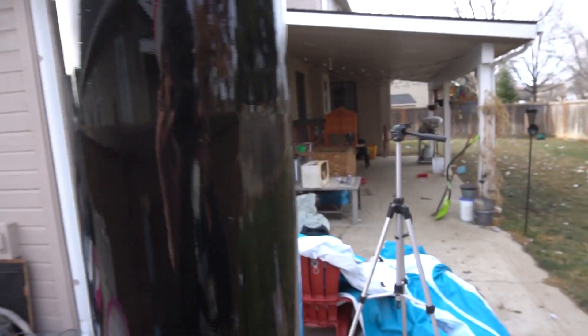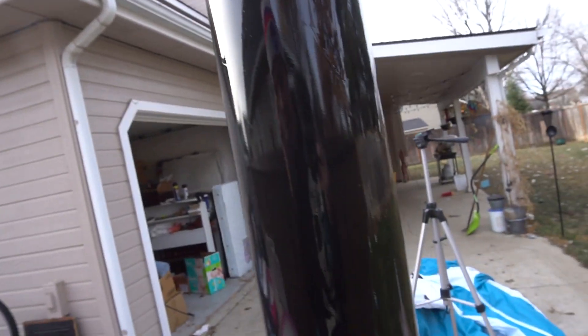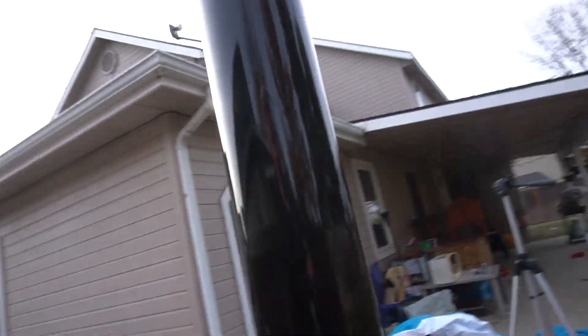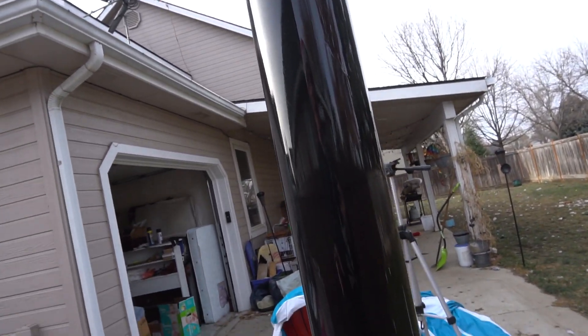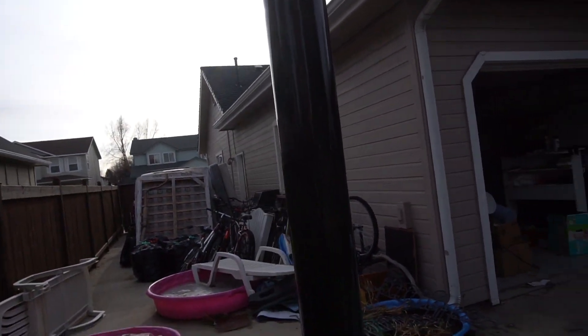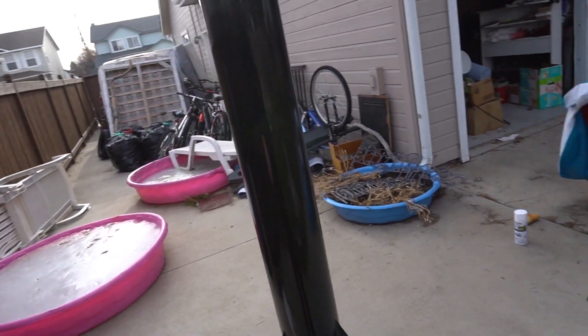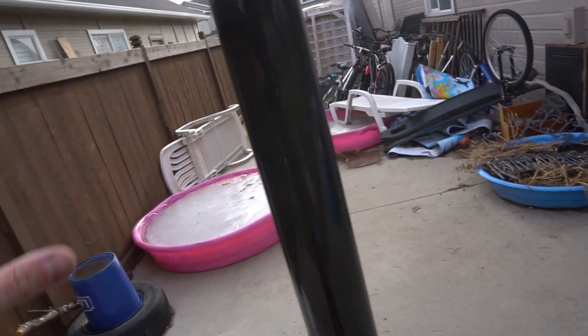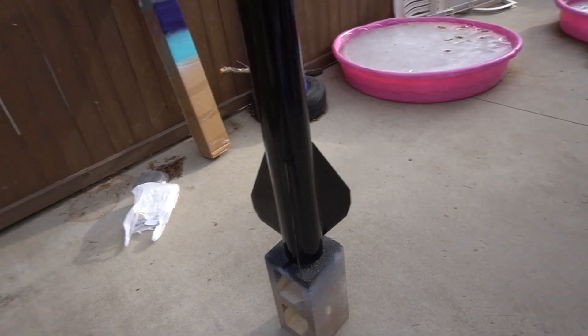You guys know I'm perfectly willing to admit when I've made a mistake, so it's time to do it. I don't know if you can even see it on camera - it's not very big - but there is a small run there. When you're painting something this big, especially when I wear glasses but can't when I have my mask on, these things happen. What I'm probably going to do is hit it with one more coat of gloss black, then come back once it's dry and knock it down with some 2000 grit sandpaper - just wet sand it to a buttery smooth finish before we spray the color shift paint. I've also been painting the nose cone off-camera - assuming the gloss black on that goes okay, we can spray the color shift stuff on it today.